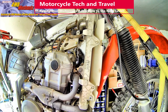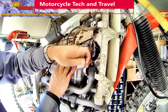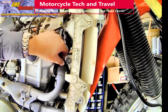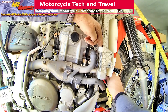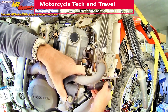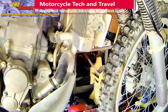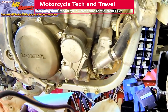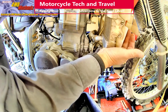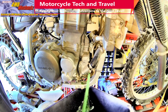Honda's 2000–2007 model XR650R is the only liquid-cooled Honda XR series motorcycle. It features a pair of radiators and a liquid cooling system, including a water pump, cylinder and cylinder head cooling jackets, and cooling ports. To keep cylinder temperatures normal, there are twin radiators with fins, top tanks, inlets, outlets, and a filler neck cap. I use Honda's pre-mixed, formulated-for-aluminum coolant antifreeze.